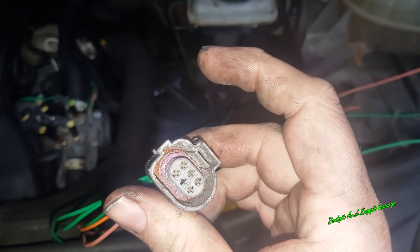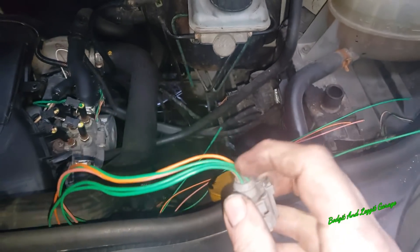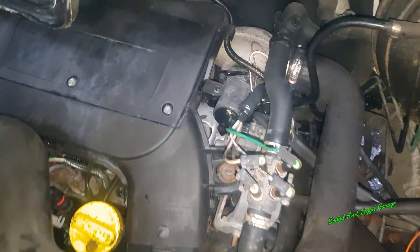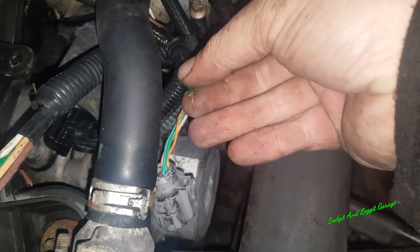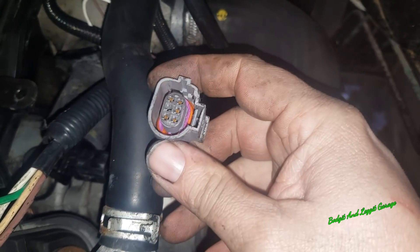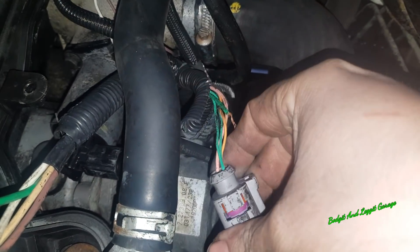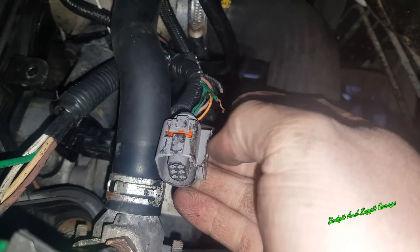So I'm going to de-pin this one. I've got plenty of wire here. We need pin number one. Inside there you can just see that pink clip — I'm going to remove that pink clip, de-pin number one which is there, remove the whole wire, and then I can solder this wire and just push the pin down into here. So I'm using the original connection, but I have to remove that pink clip which holds the pins in. Once I've done that, we can solder this and then worry about the EGR valve.